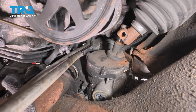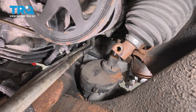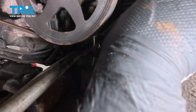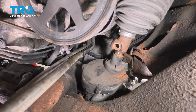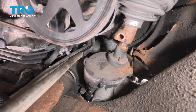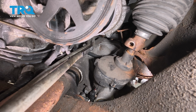If you need to, at this point, we can lower the steering rack down again, just temporarily to get that to line up. Just makes it easier to put this on before we slide this all the way up. Push it back up and get that bolt started. Use the pull jack. Just raise this back side up. All right. Looks good.